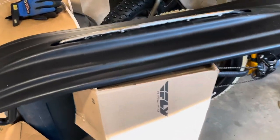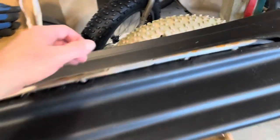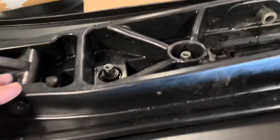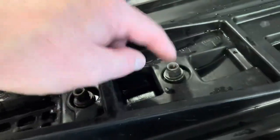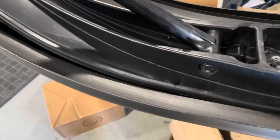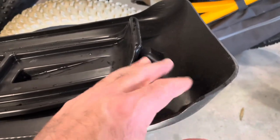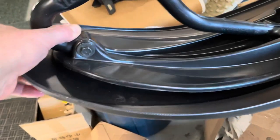Okay, so what I found to be the easiest thing to do is put your ski upside down, and then I drop the skag through the top of the ski, and it fit, no problem. I wasn't fighting anything. I was a little bit concerned. The studs protruded through. There was enough thread to easily grab the nuts. So I'll go and I'll tighten these down. And then we'll have to drill a hole there and here to rivet those in. You're gonna wanna do that, because otherwise, if you back up, you have a good chance of getting these peeling back off or getting alders, all kinds of brush stuck in there. Here would be terrible. You have a really good chance of scooping, or else you're gonna get snow and ice buildup underneath there. So we'll just make sure that's all nice and tight when I pop rivet it.